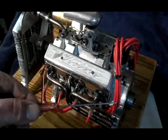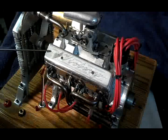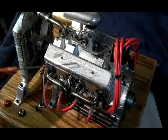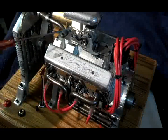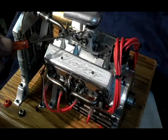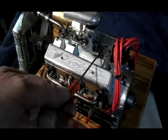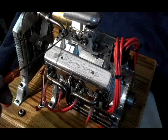I used test lead wire from Radio Shack for the spark plug wires. Rather than machining the name on the valve cover, I stuck it on from printed material and then lacquered it. I used an OS carburetor from an OS-32 helicopter engine, with a slightly different designed air cleaner. This has one carburetor, but you'll notice on the carburetor plate I have room for two — eventually I'll put dual carburetors on it.